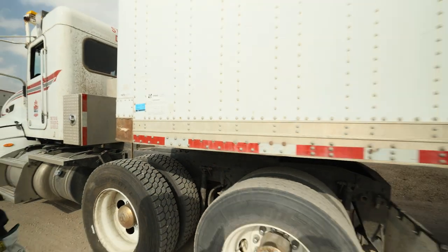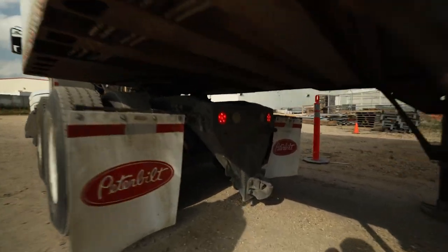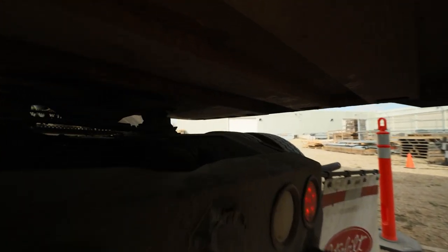Tug number one. Tug number two. Secure the truck. Most important of all now — before anything else — is verify your locks. Number one: bolt all the way in. If you see any daylight at all, you run the risk of losing your trailer. It's fully locked, no space. Handle now fully locked and pushed all the way flush. I like to just push it once to verify everything is fully engaged. Now go underneath and check the jaws are locked — fully locked, wrapped around that kingpin.